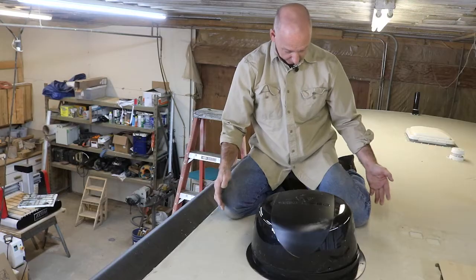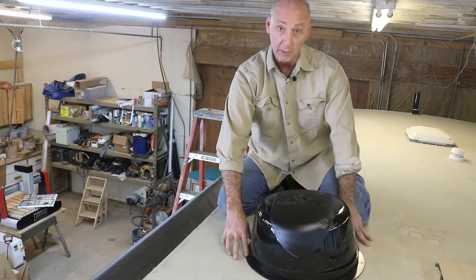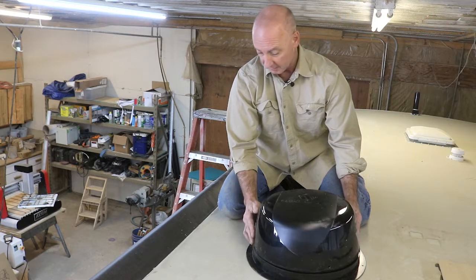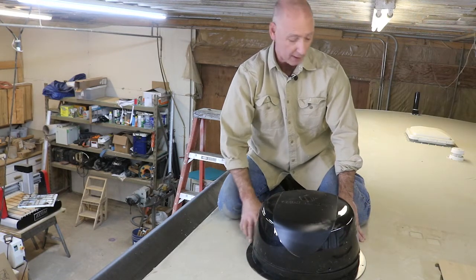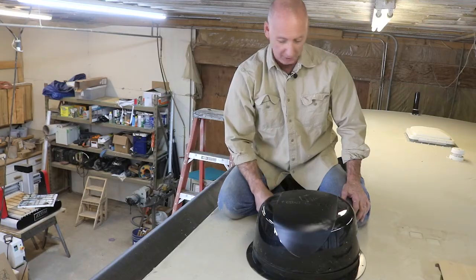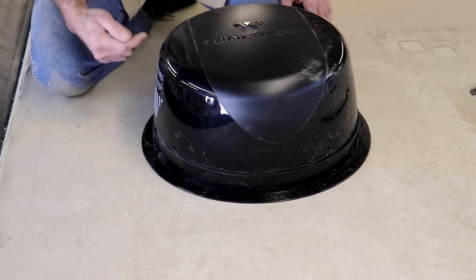Up here on the roof, this is going to be a real standard operational procedure for RVs, which is screws, butyl tape, caulk, in order to secure this. But with this in place, what I'll be able to do is get in the camper now and also start working on the router. So I'm going to come back up with all my other stuff and get this securely fastened in place, caulked in place, and then we can jump on that router down below.